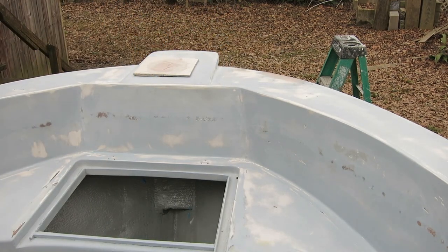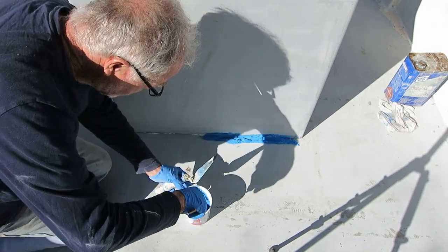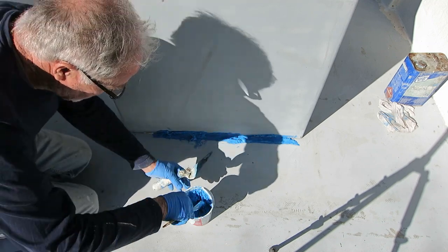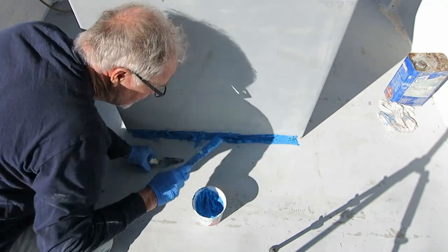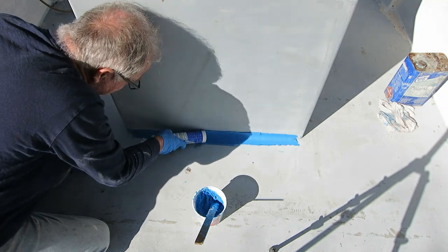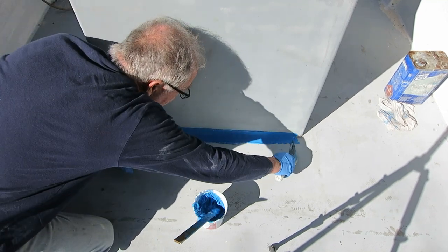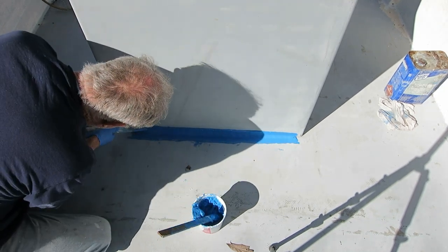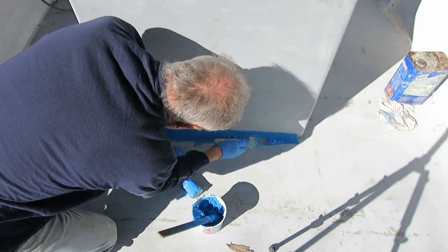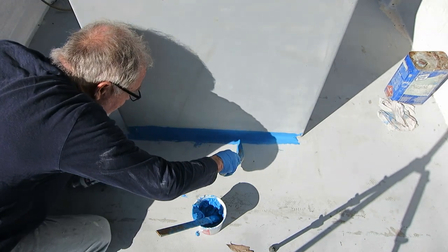The console — now that it's bolted and caulked down — I'm putting a big fillet around the circumference. This is as much for housekeeping as anything; just an easy thing to clean. I'm sure it adds some strength but I don't know how much. This is the last of my blue epoxy paint and I mixed it with poly fiber and made it real thick and gooey, making a large fillet around this thing. I'm using my caulk tube as a fillet shaper — works pretty good — going all the way around. It's probably about a half-inch radius; it's a pretty good size fillet.